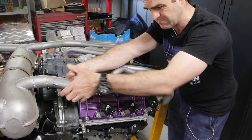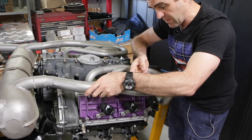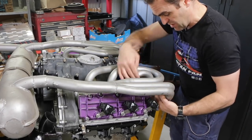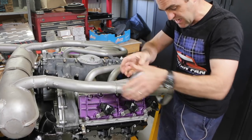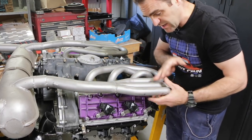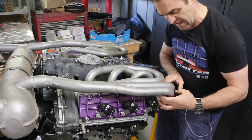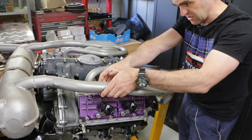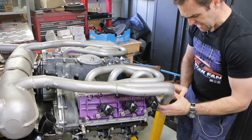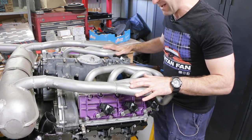One of the easiest ways is if you've got one long bit of straight pipe, you can just put a tube over it and run the tube off. The trouble is there's nowhere else to put this exhaust — I can't come right out the side, there's no space. So I need to encase the exhaust here. I'm thinking I'm going to encase these outer two runners, not the third runner, just to keep things simple with less joining around these pieces. I'll make a tube that comes along here, comes off, joins up with the tins back here, joins together, and comes up in the centre. So that's my challenge — now it's time to take this exhaust off and start piecing it together.